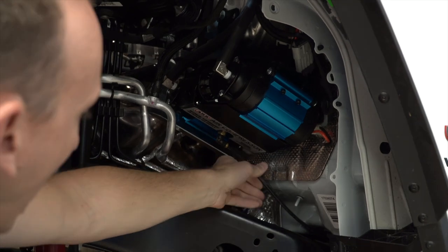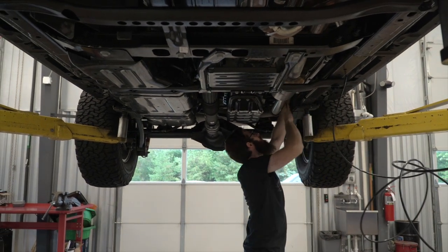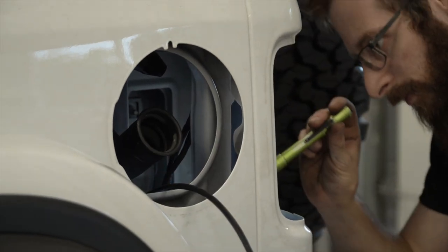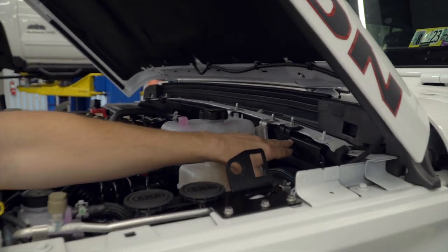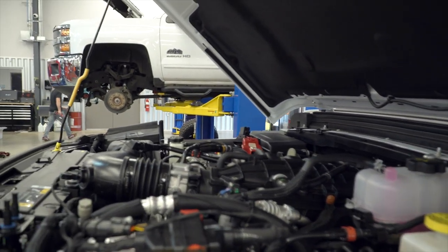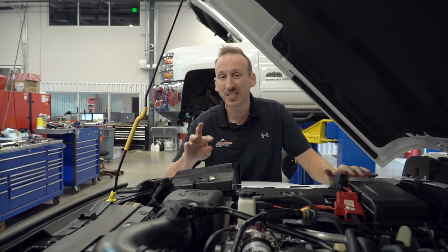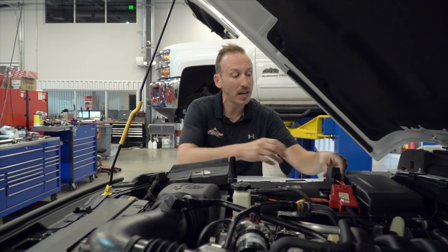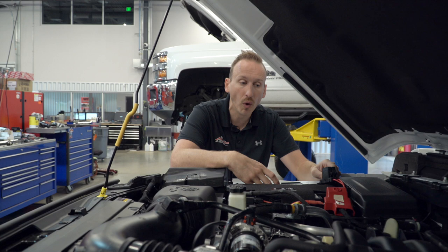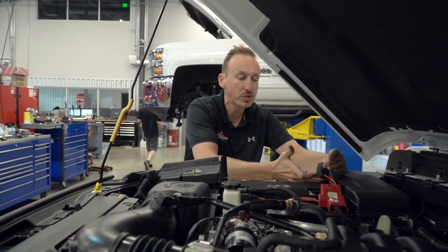As you can see, we've got the airline running right down to the back — we have it coiled up now but we're going to finish the installation and run it to the back. Wiring is pretty straightforward; we've got the ARB harness routed right behind through this channel which Jeep provides, which is super nice, over here to this factory upfitter switch. If your Jeep is a Rubicon it likely has four OEM auxiliary switches. If it's not a Rubicon then you may want to look at something like an S-Pod or SwitchPros to control all of your electrical circuits. This is wired right here — we've got two big fuses and power going to auxiliary switch number four, which the compressor uses as a signal via a relay, drawing all of its power directly from these two fused circuits.